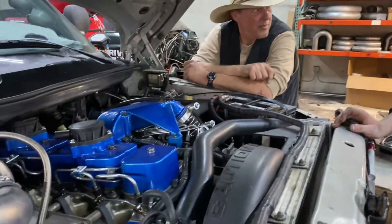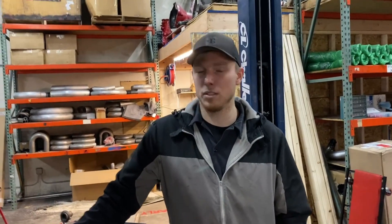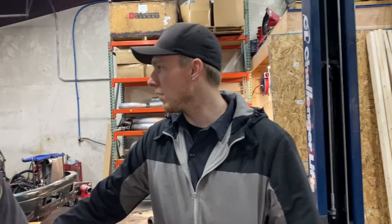It's got a 110 housing, plus a bunch of other stuff. We've got 5x14s in there right now with some pump work - an 80/215 pump. We put it on the bench and it's doing about 500-525 cc's. We took it for a rip on the street and it comes on pretty good - it's almost smoke-free. We're gonna put it on the dyno and see how much power that actually is. We've hit 67 pounds of boost on the gauge, and coincidence? I think not.